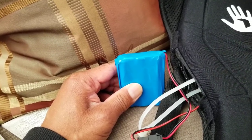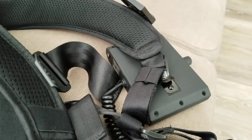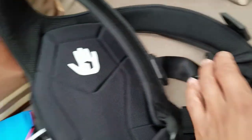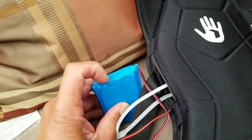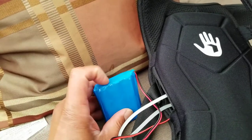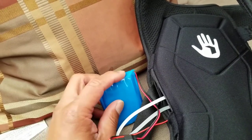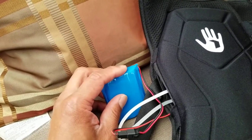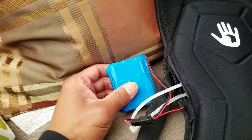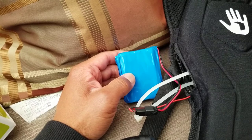I went through all that trouble of having to remove that circuit board — I think it's some sort of circuit protection board so you don't overcharge the batteries. One warning: if you're going to try to build your own battery pack, you must remove the circuit board that's soldered onto the three batteries and then re-solder it to your new 18650 battery.